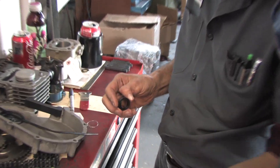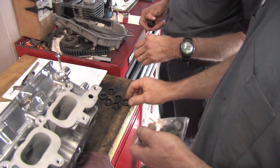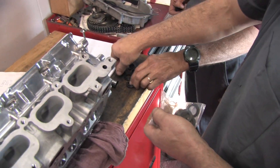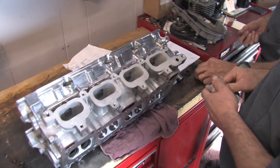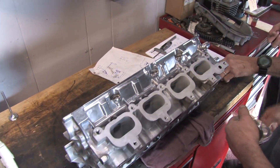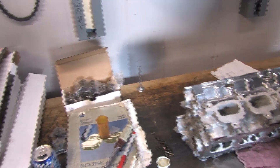Your stem height is determined by your valve job, but additional work is usually required in order to fit aftermarket springs. There may be variations between parts or differences in the valve seats that prevent you from nailing the recommended specification. The goal here is to make the valve spring pressures and spring heights as uniform and as close as possible to the installation specifications.